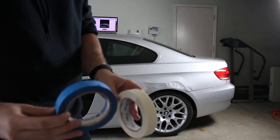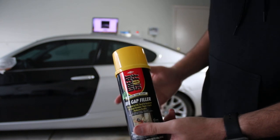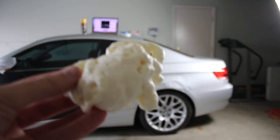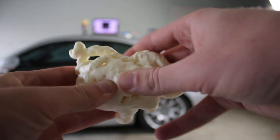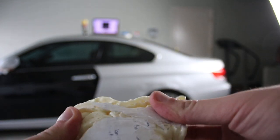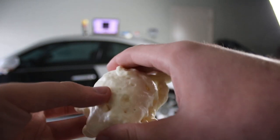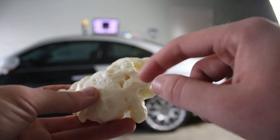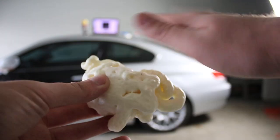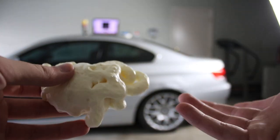With that, I'm going to show you guys what kind of materials you need to get this wide body kit on your car. I'm using just some regular masking tape and this big gap filler — Great Stuff expanding foam. This works for rust or anything you want to do with your car. Here's my practice run from yesterday — after it was cured, it's solid. When you squish it, it comes right back out. It feels really good. After you use the foam, you can use some filler to fill in all the extra stuff, then wrap it with fiberglass, and the wide body should be pretty much done.